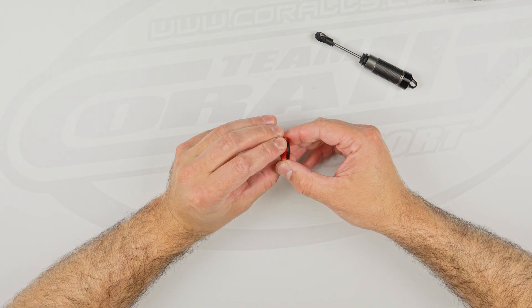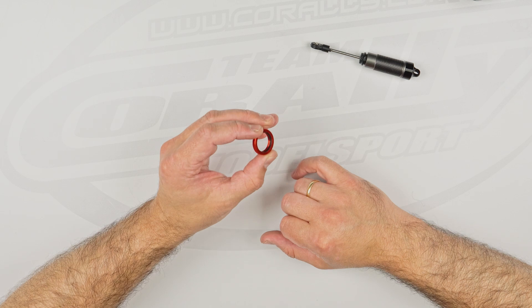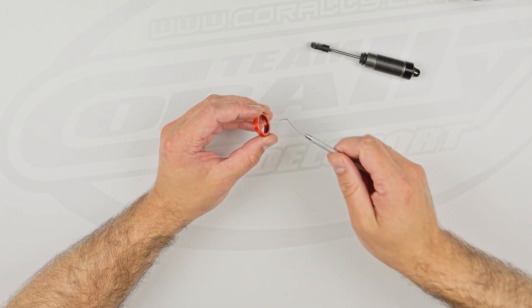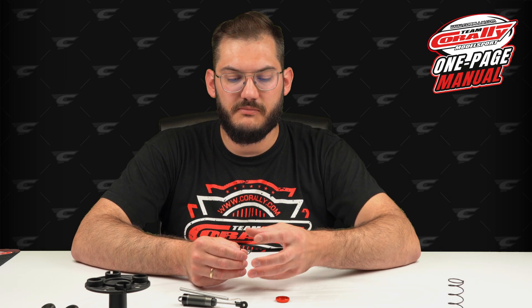As you can see, there is an O-ring inside. It's there to prevent the screws from loosening while you are driving. Make sure this O-ring is in good condition. If you want to inspect it, use something like a dental tool to get the O-ring out. While cleaning these shocks, never use solvent on the O-rings — they will swell, pop, become bigger, and will no longer be useful.